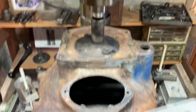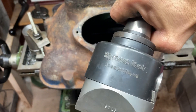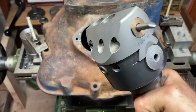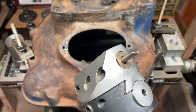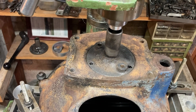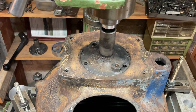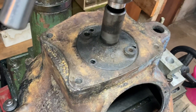This is the boring head I use. It's a little big for this machine, but if we go slow — I've used it before — it's all about the cutter and the material. This is cast iron, very easy to cut, so we don't have a lot of side force. And this bell housing is solid all the way around, which really helps with the cut.